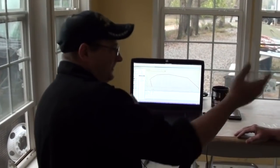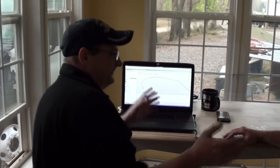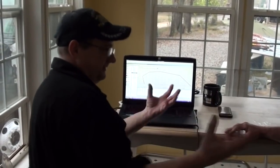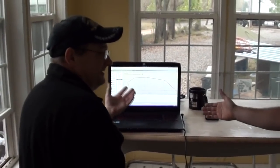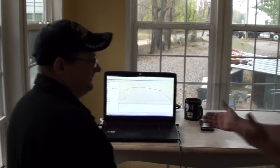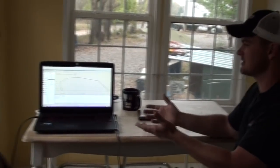Several people have told me the same trend — they learned it the hard way. It's not from an official source; it's from talking to hundreds of guys over the years with torturous engine loads. The pattern is consistent: keep RPM in the 1,600 to 1,700 range when hammering up a mountain heavy — that's where they want to run, that's where they last longer. There's less internal engine friction and less sidewall loading on the wet liners. Just because the manufacturer advertises peak torque down at 1,200 RPM doesn't mean it's good for the engine under load.